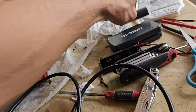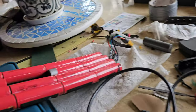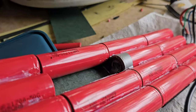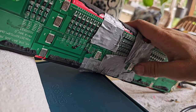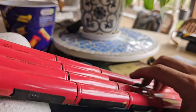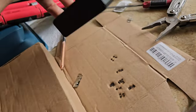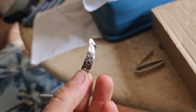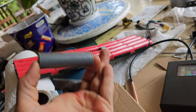I've filed down all the stuff - everything's been filed and smooth enough. It'll sit pretty well there. Just spot welding those on with the new spot welder - first time I've actually used it for things I actually need. It seems pretty good. It's not the nicest welds, it's kind of hard to get in there, but it is very solid - absolutely no side to side movement. I did an unnecessary amount and did a couple in the same spot just to make sure it's really on there. I did a bunch of test ones, getting the settings dialed in. It starts ripping the nickel strip instead of just popping off, so I think I got the settings right.